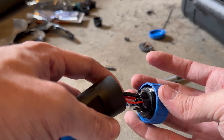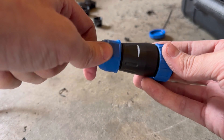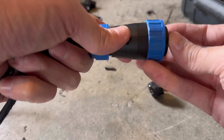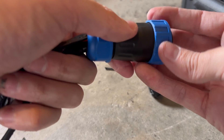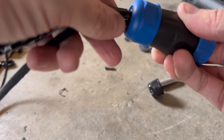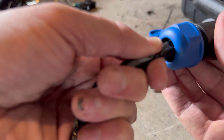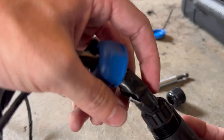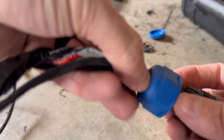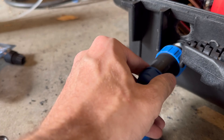I went with number one as red, two white, three blue, four red, and five black for ground. Four is the big red one — that's the 12-volt power — and five is the ground wire. So that's how I decided to wire it. I put in some extra duct tape here just to take up space and make sure no water gets in to waterproof and weatherproof this for the long term. That is my final wiring setup — it just plugs into the terminal like that.